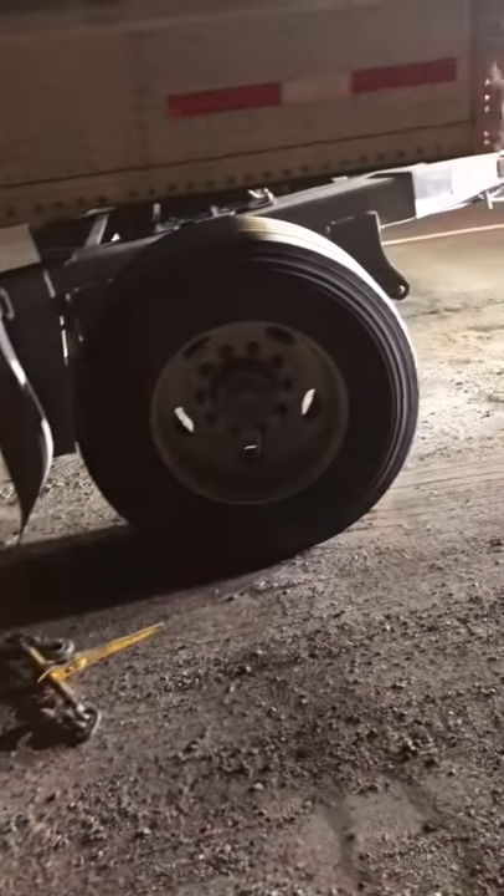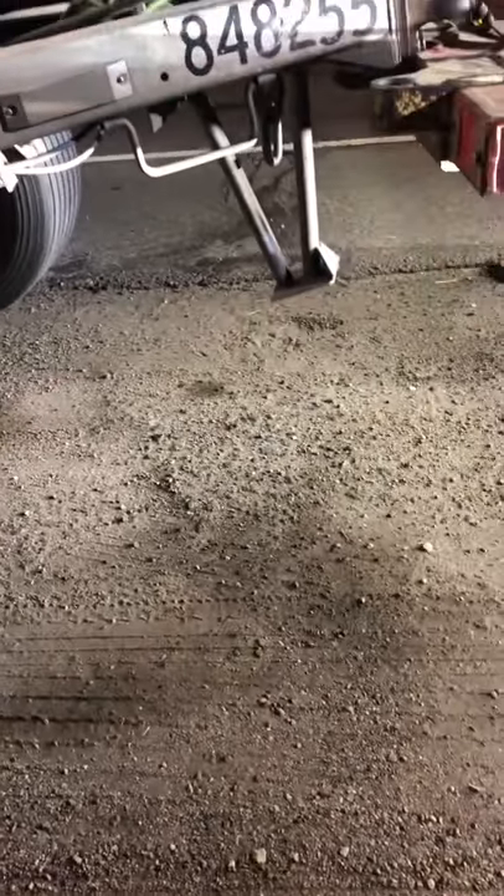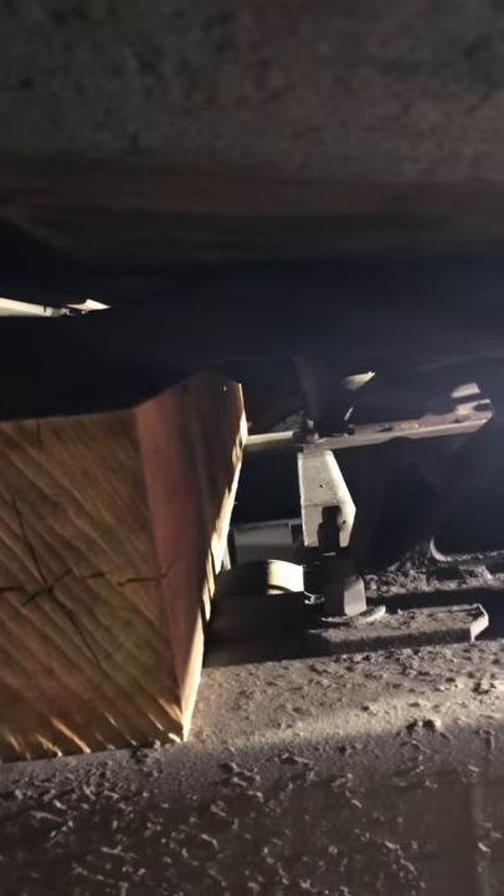Get the con gear underneath the nose of it, and then what you want to do - I like to pick it up. I know it's dark out, it's night, kind of hard to see, but pick it up and I'm gonna put some timbers in between that plate and the con gear before we chain it. That way we can keep the nose of this thing off the ground so when we pick it up it don't hit. I got the timber right across the frame rails and it's underneath that plate on the back side of the fifth wheel plate.